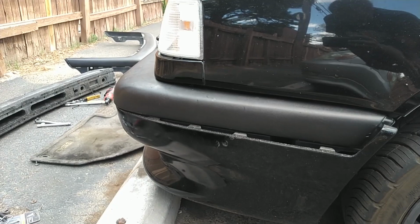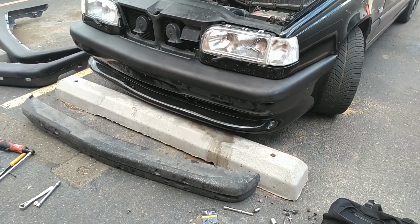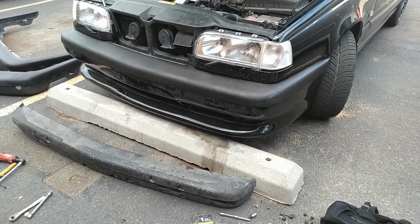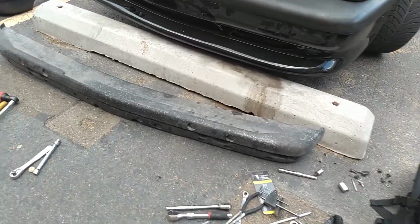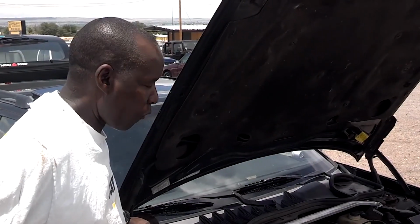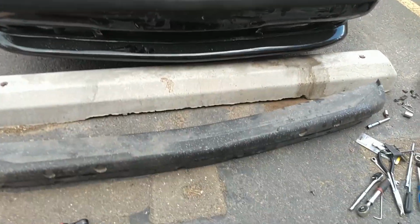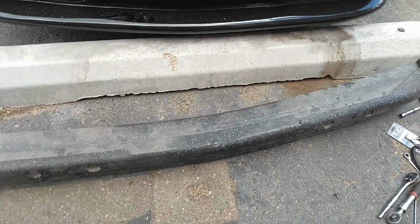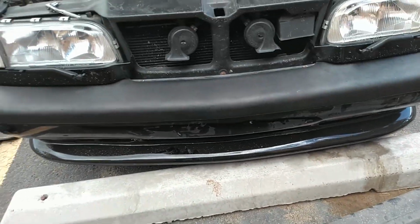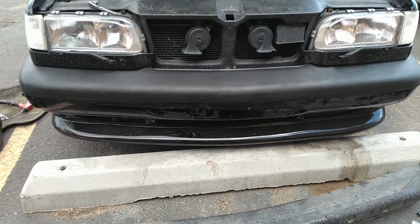So let me finish snapping this in around the top part of this bumper. I was distracted on the phone when I started this job and forgot to put my support under the bumper. I can't believe it. It looks fine, but if you bump into anything without that styrofoam back there, you're likely to crack the bumper. So I'm gonna cut my bottom piece loose.